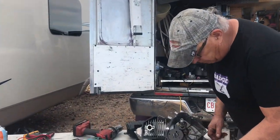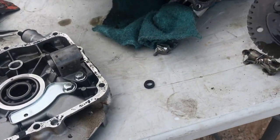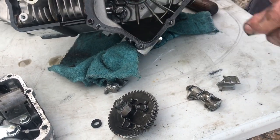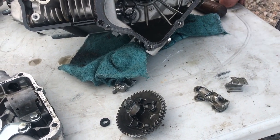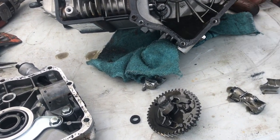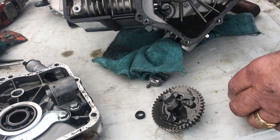You see what happened? The rod broke right there - there you go. That's exactly what happened: the rod broke and the cam broke. So this is what you classify as a major failure. Now believe it or not, that crank might be saveable. So all we really have to do is put a rod and a piston in it and we can run her.